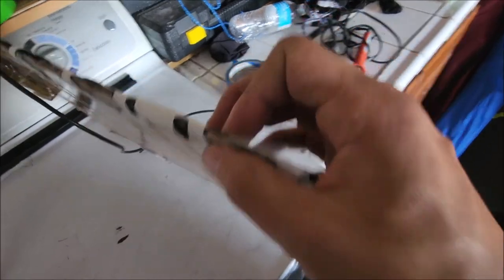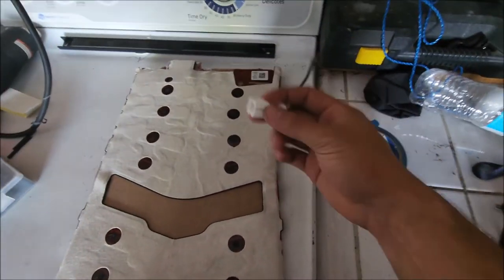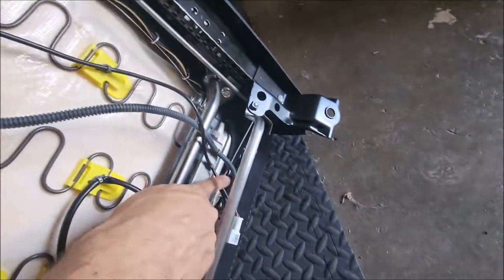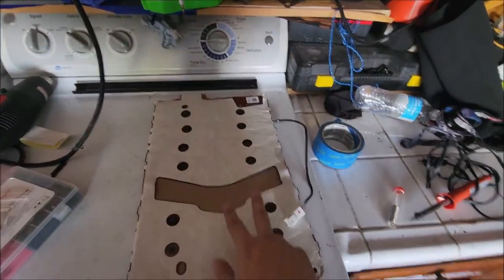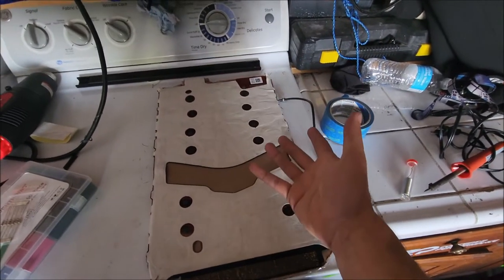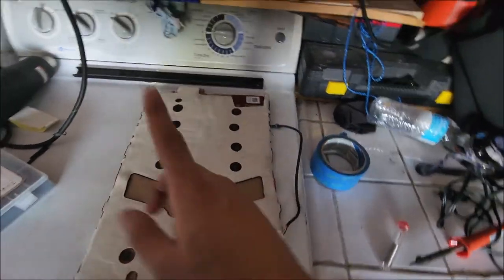I pretty much wrapped it in a piece of cardboard on the bottom. The sensor is what you're gonna solder — you're gonna plug it back into what was coming from the floor on that side, along with the yellow clip. Make sure you do both of these things for the passenger side in order for it to work. If not, you'll get the airbag light — and if you're okay with that, you can skip this part of the video.